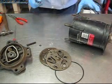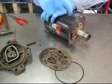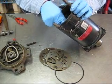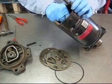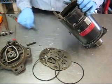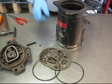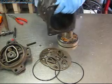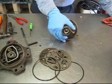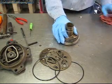Trying to clean some of this stuff too much can actually lead to problems. Next, there is another O-ring for the front head and it will also be very stuck. The easiest way is to reach in with a pick and work that O-ring out — sometimes it will come out in pieces. Next the front cylinder head will drop through, and now you just have the empty case. We have left the shaft seal in the front cylinder head to this point because it's easier to get out now that the compressor crankshaft is not in the way.